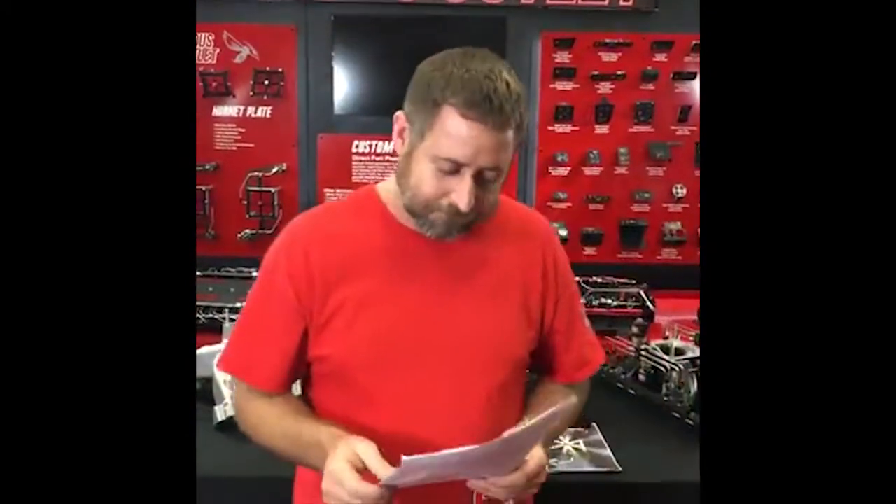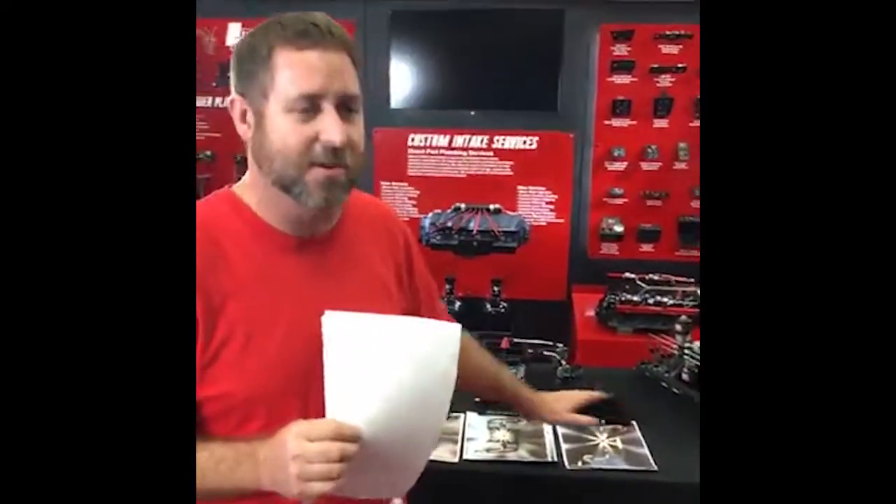Now let's look at some of the other technology out there. Everybody's familiar with spray bar style plates — they've been around forever. The nitrous industry is really known for just repackaging the same thing, putting it in a different color, calling it something different, but it's the same thing. Whenever I was tuning cars and reading plugs, I noticed that between the spray bars we had the issue with it deadheading and not spraying consistently across the bar. With perimeter plates, it comes in, goes around the other side, and the opposite side sprays harder than the entry side. If you're spraying 150 to 200 horsepower, it's really not going to make that big a difference — but when you're putting serious nitrous in the motor, that's when it starts making a big difference.